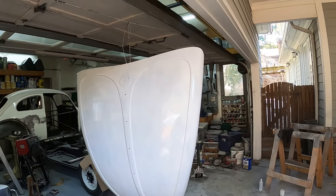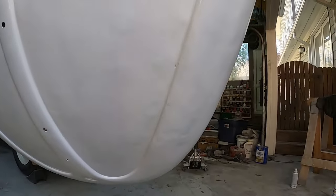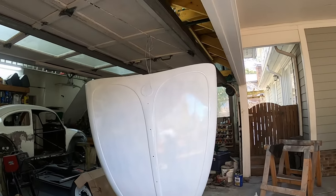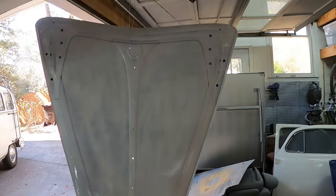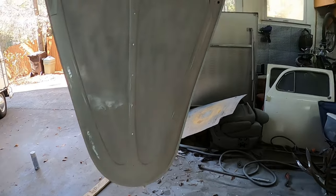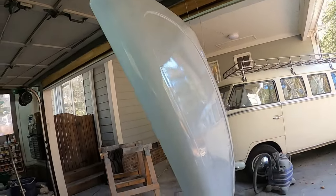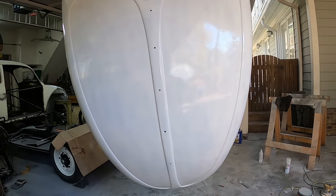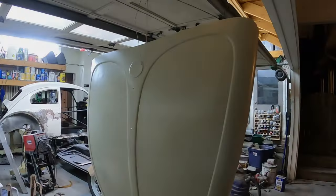I can't say that it is perfect but I got a first coat of primer on it. It exposes all the little bumps and imperfections of where I put on body filler - this is still bumpy in a couple of bad areas. But this car is going to be imperfect. The back side you can see where I didn't remove all of the paint. If I had some high build primer I could get rid of some of that, but I'm going to put probably three coats of primer on it before I put the lotus white on it.